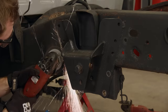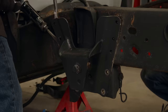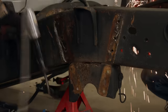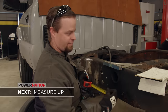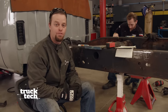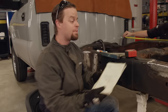Cutting off the front spring hangers can be a chore. These are aftermarket hangers that somebody welded to the frame, making our job quite a bit harder. Always wear the proper safety equipment — throw some sparks and stick with it and they'll eventually come off. Once everything is removed, grind all the welds smooth. We're right in the middle of dissecting our 2003 Duramax. Not too long ago we made a trip to the junkyard, pulled some measurements, and took some notes on a short wheelbase frame, then came back to the shop and compared them to our long wheelbase.